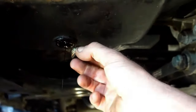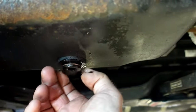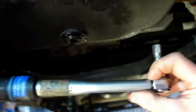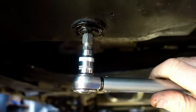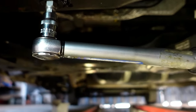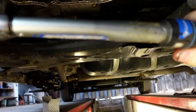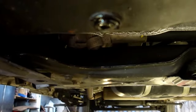It's all nearly exhausted now. So I'm just going to pop that plug back into the sump like that and just take her up. I have my trusty little torque wrench here. Recommendations are about 25 to 30 newton metres. So this is actually set to 30 newton metres. Let's just tweak her up. There she goes. I'd have probably gone a little bit more tight than that. But there we go - that's 30 newton metres, clicking away.